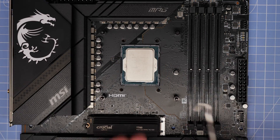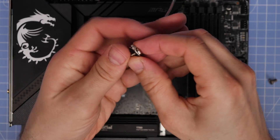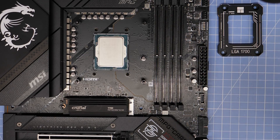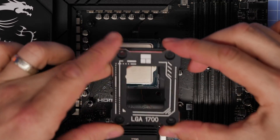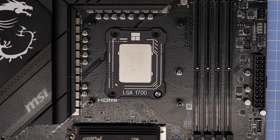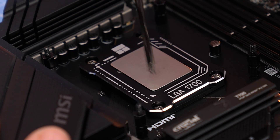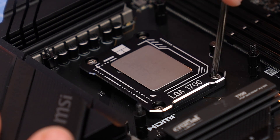Now put the CPU back into the slot on the motherboard, carefully lowering it down and installing that. Then take the screws out of the standard bracket that you've just unscrewed, because we're going to need to reuse those for the installation of the contact frame — there are no screws included with this contact frame, you have to reuse the standard ones that come with the motherboard. Then we're going to seat the contact frame down over the top of the CPU, carefully and gently lining up with the bracket on the rear, so that we can put the screws through those holes and basically replace the standard setup. You'll see how it nicely sits over the top of the CPU, and this is actually beneficial because there are no gaps around there either, so no thermal paste is going to end up splurging over into the edges and making a mess.